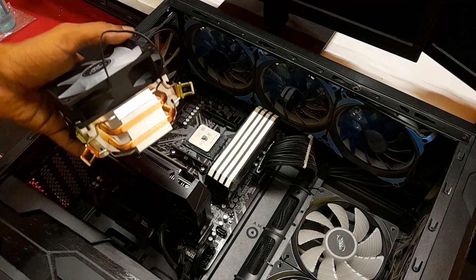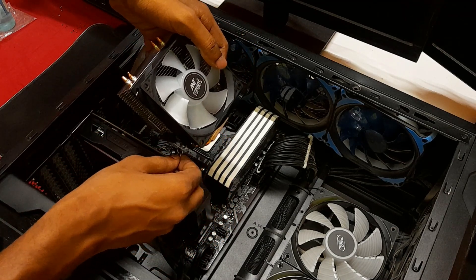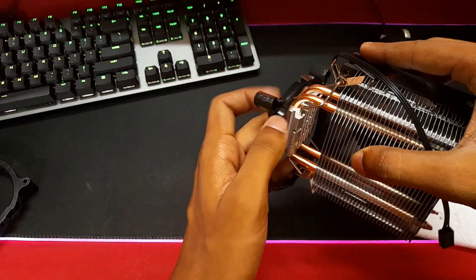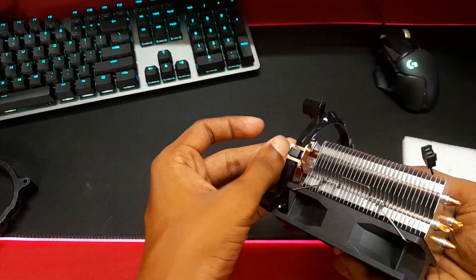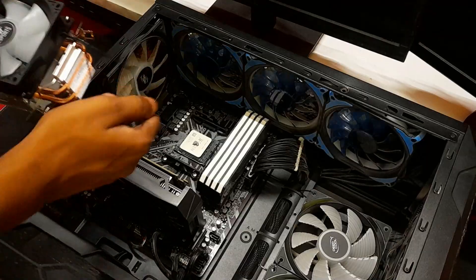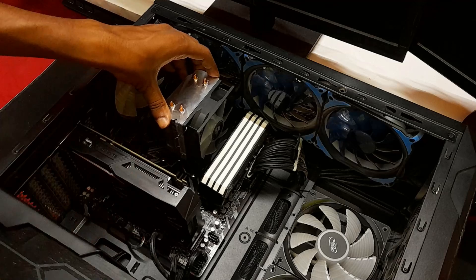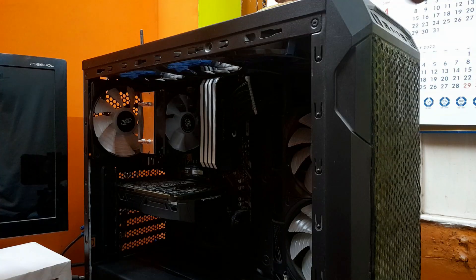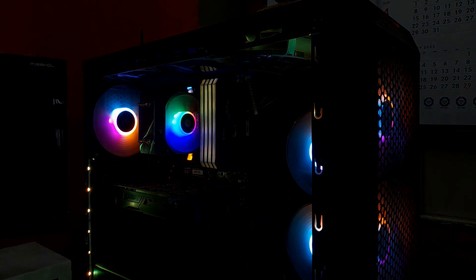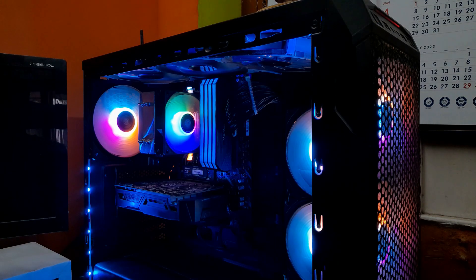Once done, you're ready to install it. The most challenging part is the two clips on both sides of the cooler — these go onto the hooks on your mounting brackets. For Intel-based mounts this is how you clip it onto the brackets, and the same applies for AMD brackets. It looks really simple on the table, but inside a PC case it is a real struggle. It took me roughly 10 to 15 minutes to figure out how to fit my hand in those tight spaces and get the clips locked on. Finally it was done — and don't forget to connect the power cable for the fan. Turning on the PC lights everything up nicely.